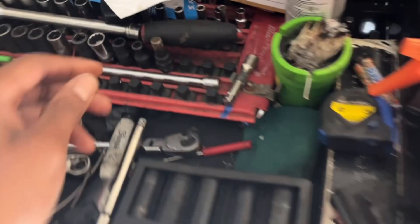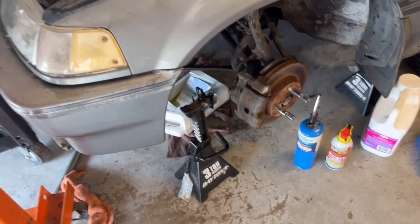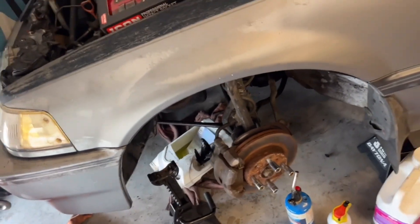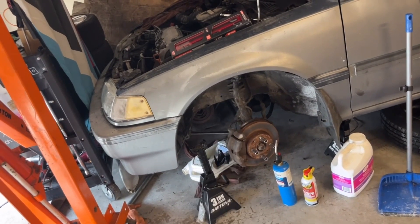So we made it back to the house. Step over here to the toolbox — we got two broke extensions because I tried to use a 3/8 ratchet and extension to break that crank pulley bolt and it didn't work. So we went up to Harbor Freight and got us some proper half-inch extensions. We got our floor jack down there, PB Blaster, we've heated this sucker up, we've used two impacts to this point and nothing has worked. Engine is running as y'all seen in a previous video, but we need to change the water pump. So this next task is fighting that ignorant crank pulley bolt.